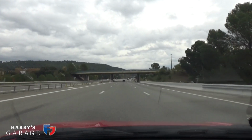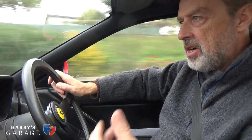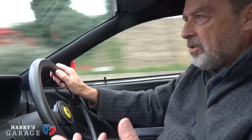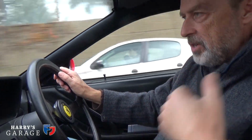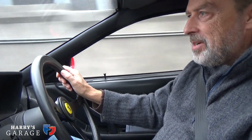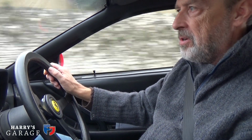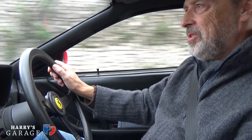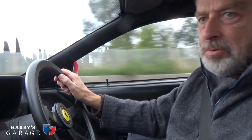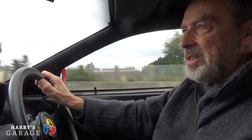The heater issues with the Testarossa are sort of forgotten about now, because it's about 12-14 degrees outside, and the cabin's absolutely fine, so you wouldn't know there was an issue with the heater now. The Testarossa is still really impressive for this sort of long trip, because it's got this monster great fuel tank. I measured it twice, I brim checked it twice. You get a knock on the door of 400 miles from a tank, which is really quite a lot. And the first one was 20.3 to the gallon, and the second one was 21.2. So yeah, not bad when you're on the cruise. As I say, it's an indicated 90.